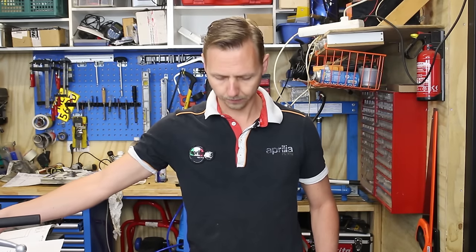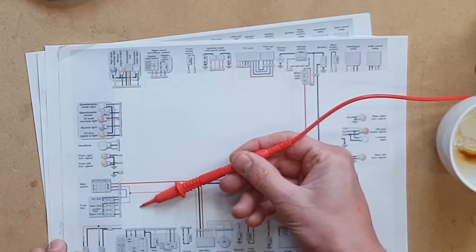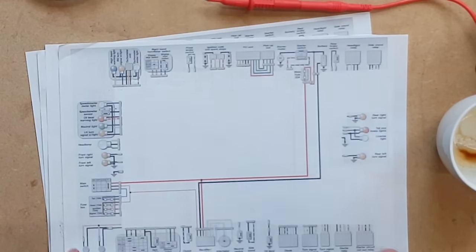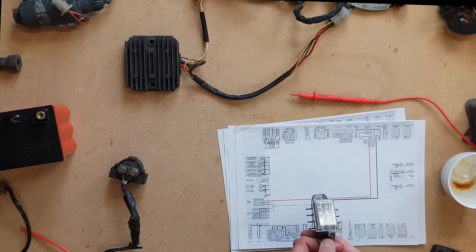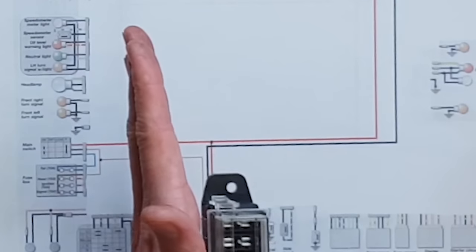With the basic leads in place, we run wires out of the ignition switch — current flows when the switch is closed. Certain parts need a positive wire from here, which you can split to a fuse box. A typical fuse box has four fuses — one for tail or headlight, one for signal lights, etc. The fuse just passes current through when intact and pops if too many amps flow, protecting the circuit.